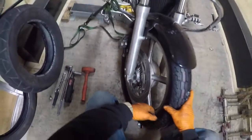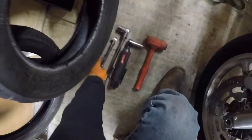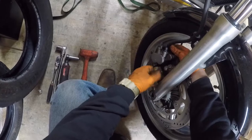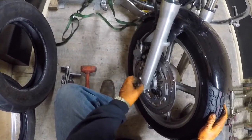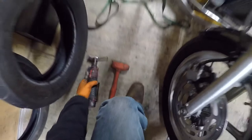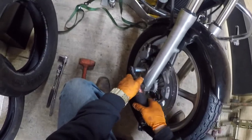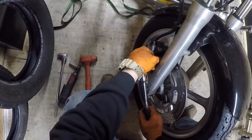Go back to the other side. Check your brake pads — these are looking pretty low. Slide the caliper on. Take our caliper bolts and get them started. Axle bolt — get that started, then I'll run that all the way down. Run these bolts down. Swap out the sockets.